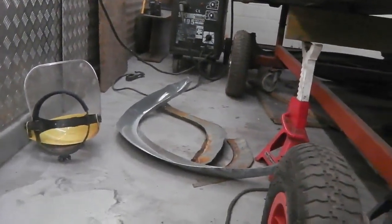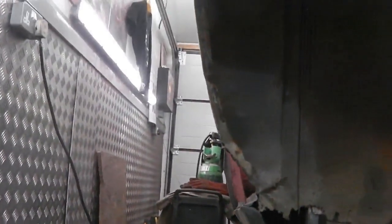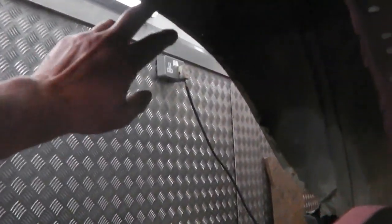We've also stripped back the wheel tub here, the wheel housing, and we can see where we'll need to do some local repairs. But for an old car, considering these are normally completely gone, it's actually in good order. It's repairable, that's for sure. It's not holed through, that's just rust that we've got around the surface. There's a couple of perforations and it's not even thinned out. We have got a repair arch just right in the middle of the screen. You can see it lying on the floor. That's a lip repair piece which we can use if we find anything on the tubs actually thinned out. So we'll investigate that later. We don't even really want to give that any thought at the moment.